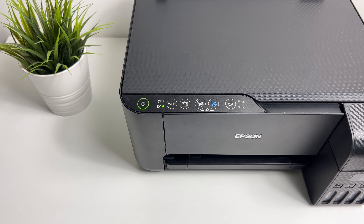You can check out the link to the video in the description. Always remember that this printer has a unique Wi-Fi name — for you to connect to the printer via Wi-Fi direct, you need to go to your Wi-Fi settings on your phone and select this SSID before you print anything. If you don't like switching between Wi-Fi networks, instead you can pair your printer to your home Wi-Fi network — this way you can print any document anytime without having to switch.